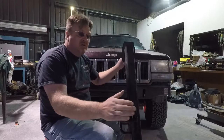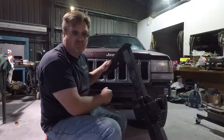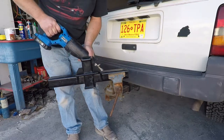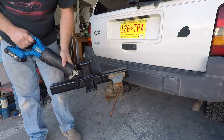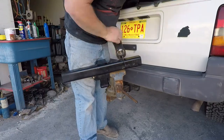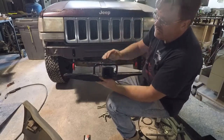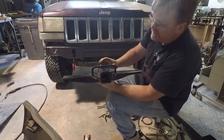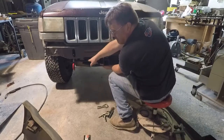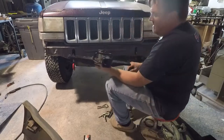Here I've got another receiver for the rear of a ZJ, and I'm going to modify this to install on the front of my ZJ. Here's what I've come up with: I'm going to take the old hitch, flip it upside down — I've cut away a lot of it and added a tab to the top. We're going to slide this under, with each edge bolting to the tow bar mounts and one bolt on top to triangulate the whole thing. It should bolt in nicely.